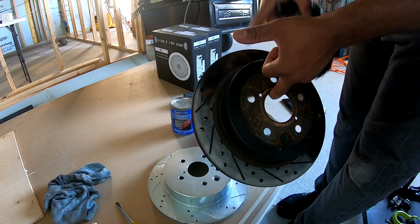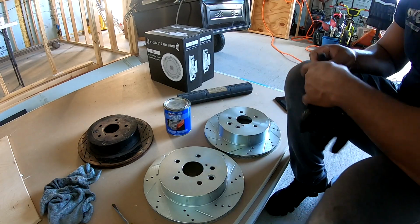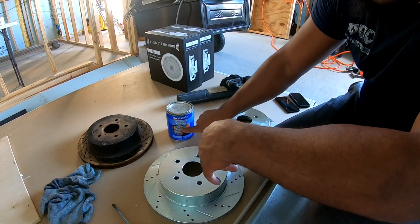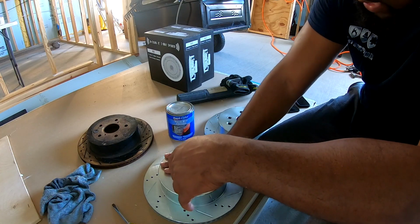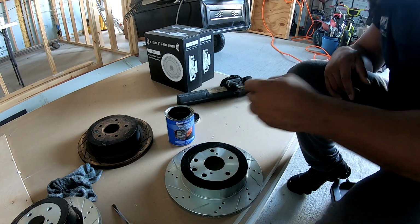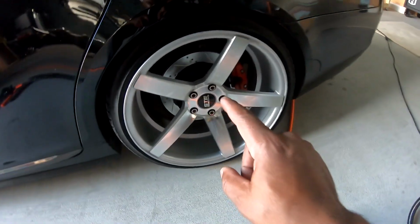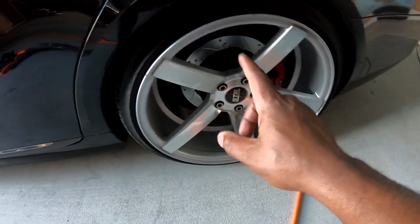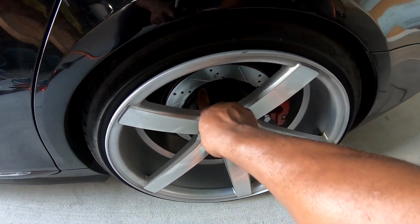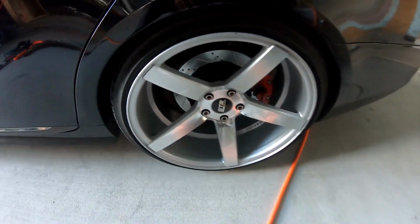Also, your G2 brake caliper kit, black, also works right here as well. I had a can of Rust-Oleum black. I don't know what I did with it, so I'm gonna use this all black truck bed coat. We're not using it for anything but the appearance, and this is the best, most durable thing that I got, because I'm not gonna use black spray paint. That's out of the question. Ooh, see that? That's all you want. You just want that black drum behind there. You just don't want to be able to see rust in a year's time or so. That's the main thing you want. Look at that. Now all I gotta do is hit the brakes. When I hit the brakes one time, it's gonna create a perfect line on the edge right here. It's gonna break all that off, and it's gonna be a nice, fine, clean line around the edge.